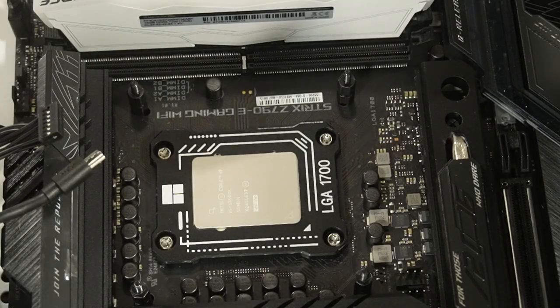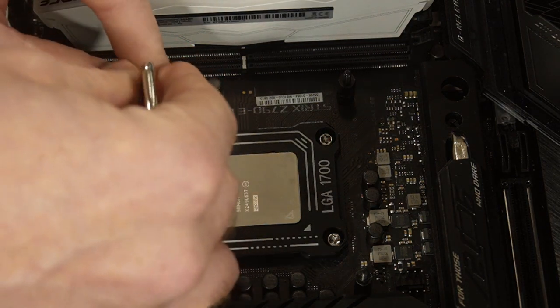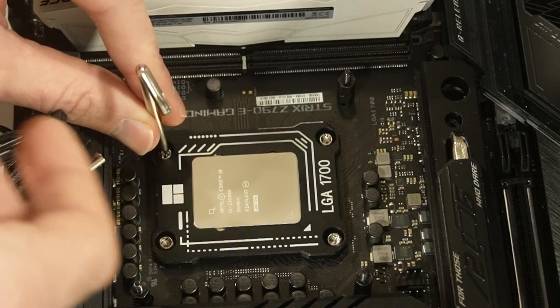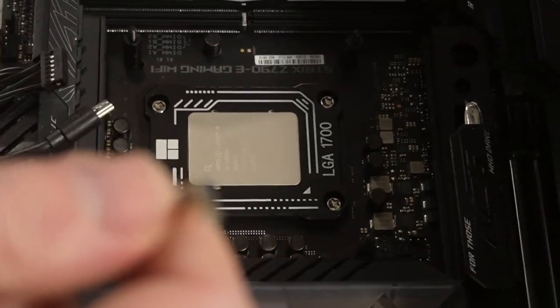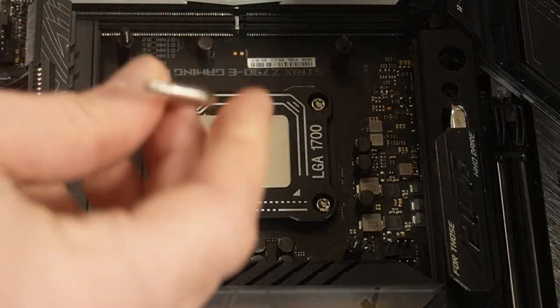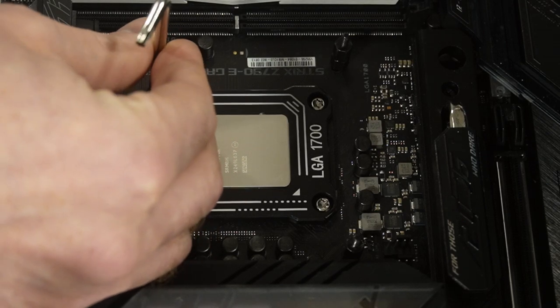So the first thing you want to do is step these off a little bit to make sure they seat right. How you do that is you put the first one in and you go counterclockwise because that's the loosening direction. And you're supposed to hear a click. But I think what's happening with mine is I don't think the bottom is... there it is. So if I hold it up, with my left hand underneath the motherboard, now we're going to turn this way. And you hear a little click.